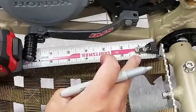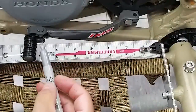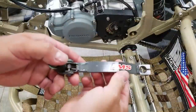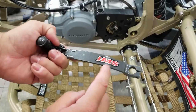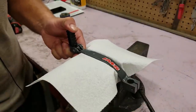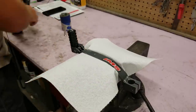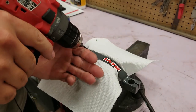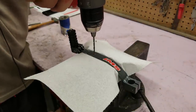This shifter is way out there right now. The center of the foot brake is at five inches, so I want to do the same with this shifter - five inches is right about here is where we'll drill our hole. You can see that's quite a bit shorter than it comes out of the box. This should be really easy to do - probably just a drill and a hacksaw. I'll center punch this so the bit doesn't walk. You could use this same method on any dirt bike or quad to adjust shifter length.